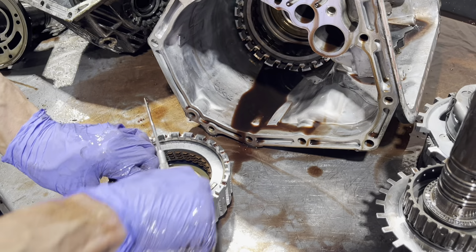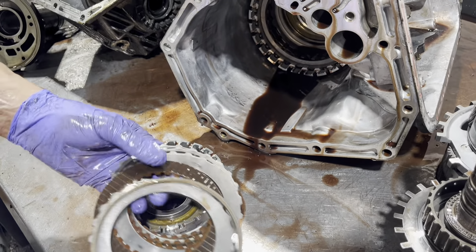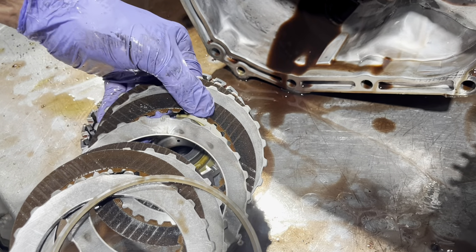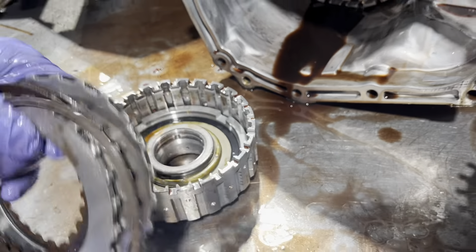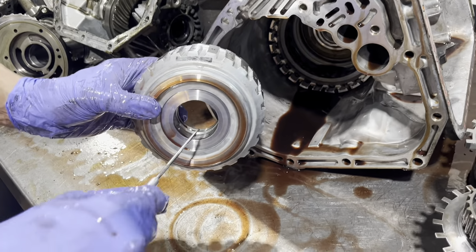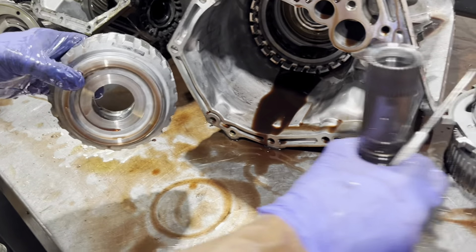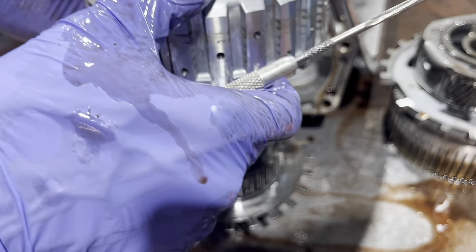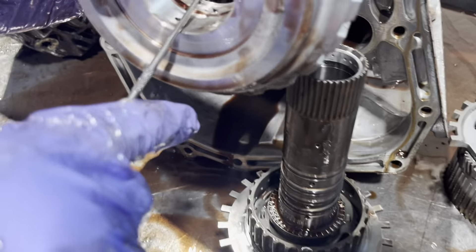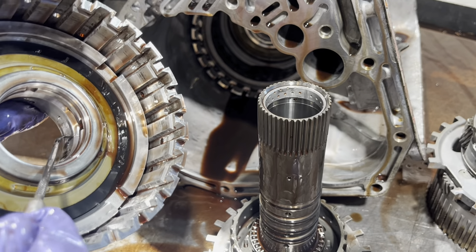Now this is your high-low reverse clutch. This is going to be burnt too — yeah, it's starting to go. The little hot spots on the clutches are kind of blacked out. We want to look in here to make sure these rings don't look too great — they kind of wear in. It's always worth looking in here because sometimes they're kind of damaged.